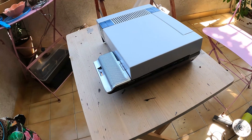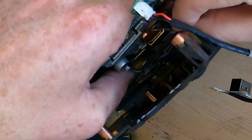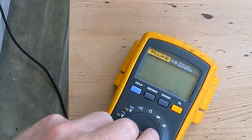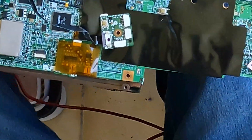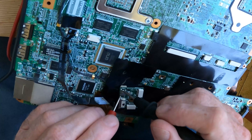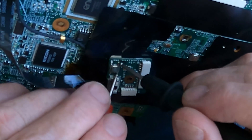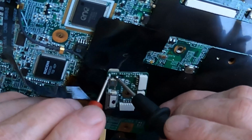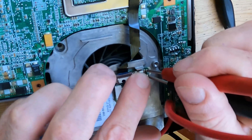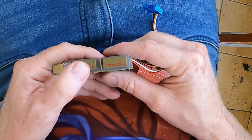You really can't tell from the front — can't say the same for the back. Before we screw down our motherboard we need power and our third USB. There's our power. I'll put on a beep test to figure out which direction the switch works in. There are two main types of switches: switches that latch when switched on, and momentary switches that are only on while the button is pressed. The reason why this is beeping is because these two are connected together but across the other direction it is not. So if we swap our power onto our reset, power is a push button and now our reset is the toggle.